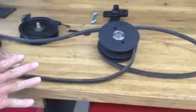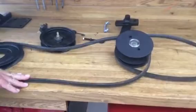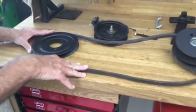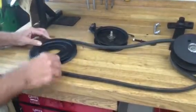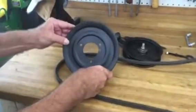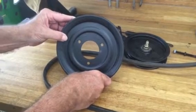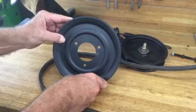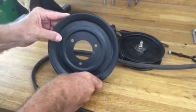You'll need to remove the belts. It is recommended to replace the belts at this time to get the best performance from the overhauled variator. To replace the long belt you'll need to take this pulley loose from the transmission. You cannot get the belt off between the transmission and the pulley — there just isn't enough room, and the service manual says you have to do this, otherwise you're going to cut a new belt or damage it.